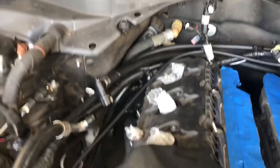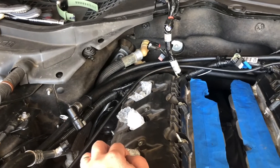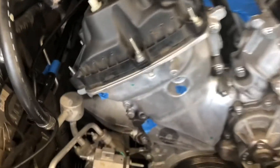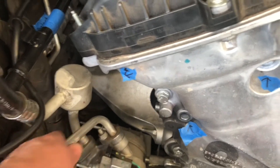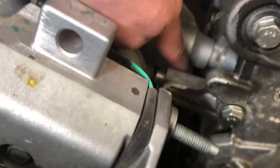There's really not much to this — it seemed more difficult than it really is. I was super scared but I'm ready to go. You do not have to take out your AC compressor. Unbolt it — I believe it's three bolts — and just move it out of the way. These are all flexible lines so you're not going to damage anything. There's also one more bracket down here — two brackets for this wiring harness and the transmission cooler lines get bolted to that, so make sure you undo that.